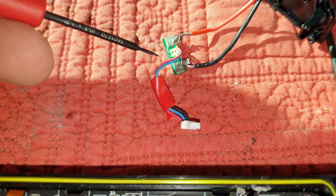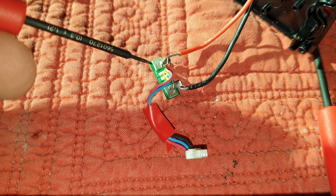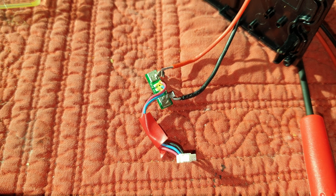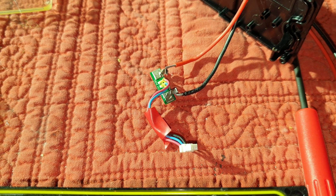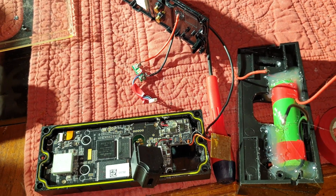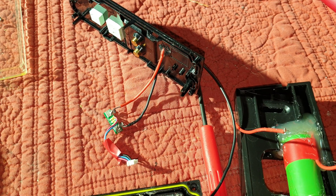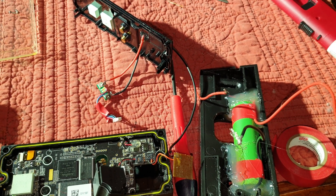For a moment I thought the controller might be bad, but I tested it and the controller is fine — 100%. So definitely the battery is just done. It's been about two and a half years, which seems to be the lifespan. Some people say it's garbage and you can't fix it, but yes you can. I'm going to assemble the whole thing and test it in part three — to see if the battery was actually the issue and if it's possible to get it working with the 18650 battery.